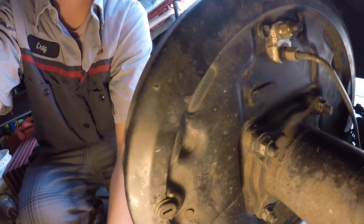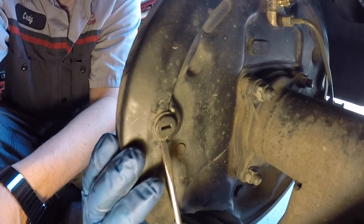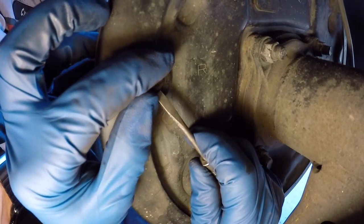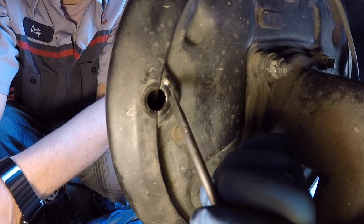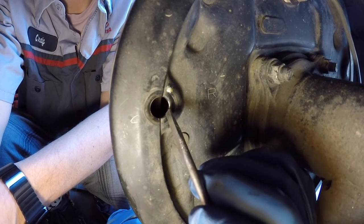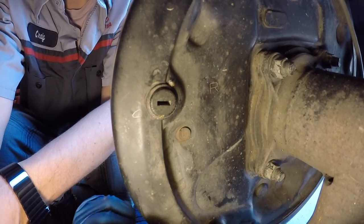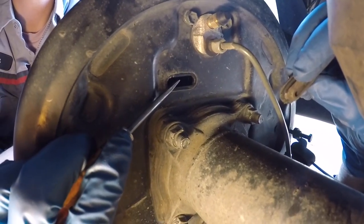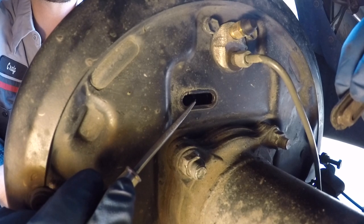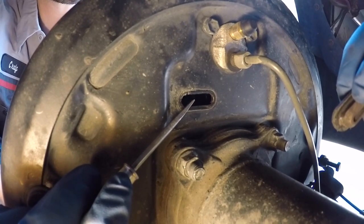I'm going to show you two access plugs on the back of the backing plate. We're on the passenger side. The first plug, which blends in so don't freak out if you don't find it, is on the front edge — this is the access rubber plug so you can see the thickness of your pads. The second plug is the one you'd take off to adjust the brakes for a final adjustment, or to loosen the brake pads so you can get the drums off more easily by turning the automatic adjuster through the hole with a screwdriver or specialty brake tool.